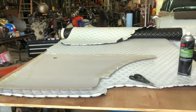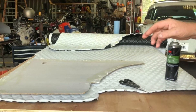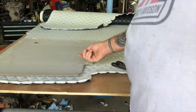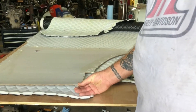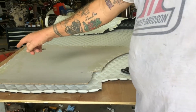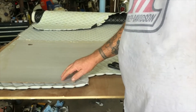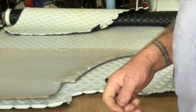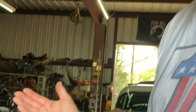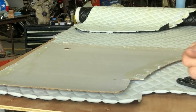These panels will be held onto the car with trim screws and some trim washers, so I'm not putting nails or any of the factory-type way that they fixed them on. On this panel, there might be three, maybe four screws that hold it on. On the door panel, there might be five, and they're a chrome screw. They'll look okay — back to the way things were done in the 60s and 70s.